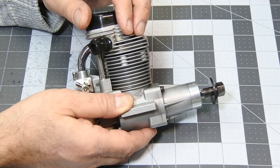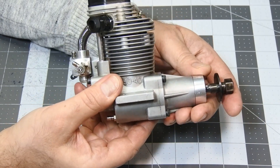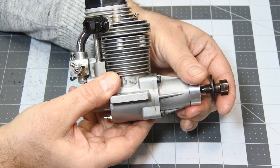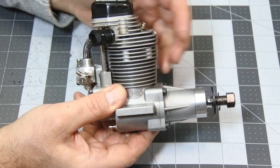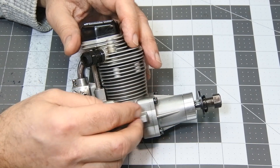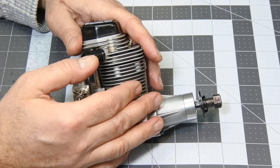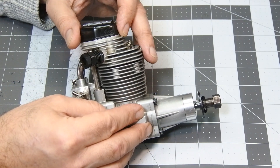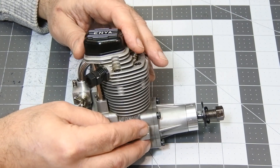After cleaning and assembling, it was found that the engine has some hiss at the compression stroke. This hiss, according to my understanding, has only one reason: exhaust or intake valves, or both of them, couldn't sit tightly in their saddles. Basically, it should not affect seriously on engine performance, but due to my pattern of perfectionism, I can't leave it as is.